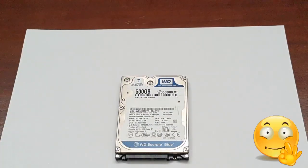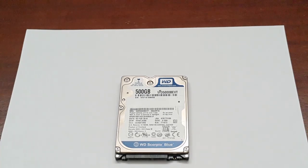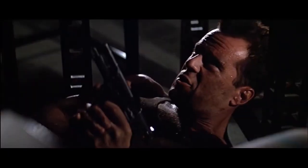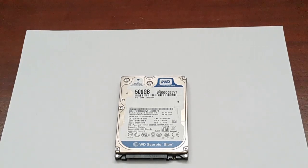This trick definitely does work for hard drives that don't have mechanical failures, so read/write heads are fine. When I removed the PCB for the first time I noticed this discoloration of the pads and said, well, this would make a great YouTube video for anybody out there that has issues with their hard drive being detected sometimes and other times not. I would definitely recommend that if you have Western Digital drives — regardless of form factor, 2.5 or 3.5 inch, whether in a laptop, desktop, or NAS — that you regularly inspect them by removing the PCB and checking the state of those surface pads. Because you might prematurely discard them: those surfaces become oxidized and you'd think the hard drive has failed, basically throwing away a perfectly good drive, especially if you have large capacities.